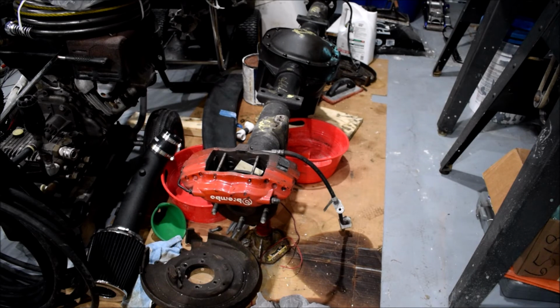I'm also going to have to have these hubs machined down on the axles to the 67.1 millimeter spec that both the Tacoma and the Evo use, obviously, so that the rotors fit, the wheels fit as stock. I'll also be knocking out the wheel studs there and putting some extended ARPs like I have on my truck currently, just so that it all matches. But that is the whole of what I have planned for the truck as far as upgrades go.